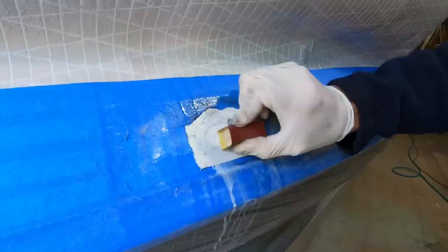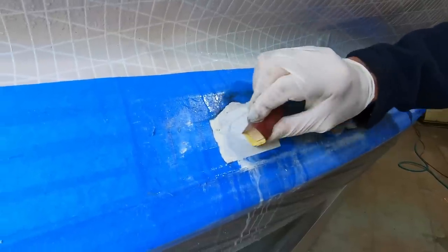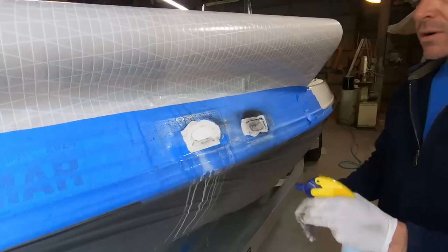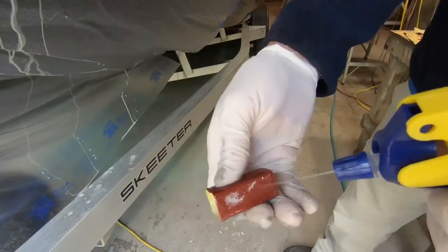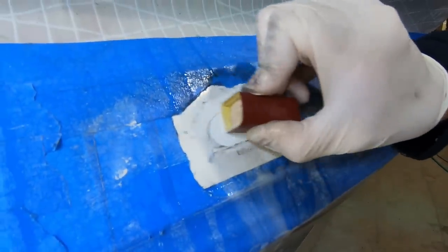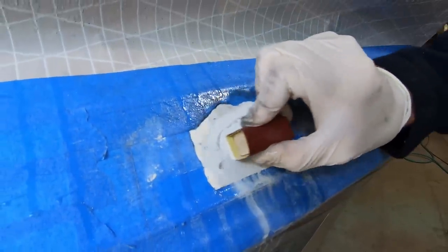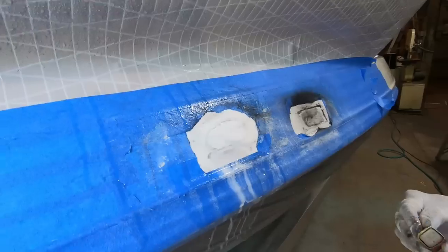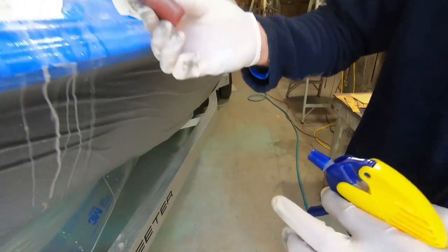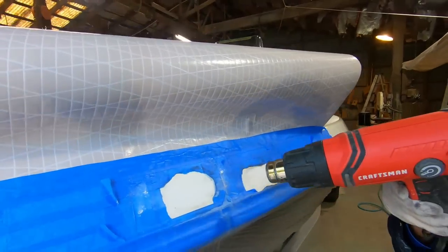Just take your time — this is finesse work. You can see the residue coming off. Give it a little bit of water to clean the paper — you can see there's a little bit of loading but the water will help rinse that out. When the gel coat is fresh and new it's going to be a little softer — it's hard but not fully cured at this point, which again is good. Feel free to rotate the block. The only edge I don't typically sand with is where the fold is — that could leave a little groove or crease. We sanded all the guide coat off with 400 grit, then rinsed with water.